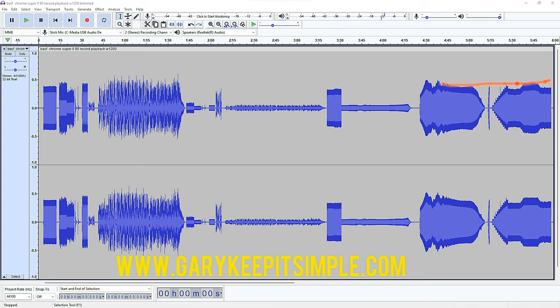Now, looking again at these tracks of these tones, you can see there's a peak at the end there that is plus 3 dB, but the tape deck can't actually drive it to plus 3 dB. So you get a very soft sort of compression effect, which doesn't sound bad, and that's why I haven't bothered including distortion figures on this one, because there's hardly any. Even when driven to the full limit, it doesn't actually produce distortion figures.